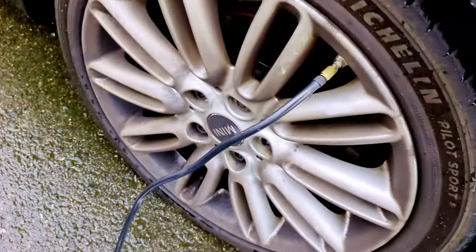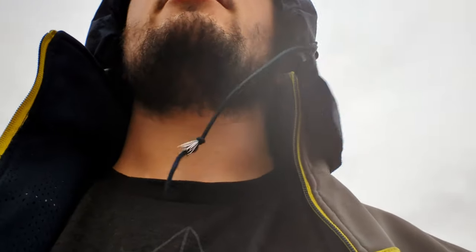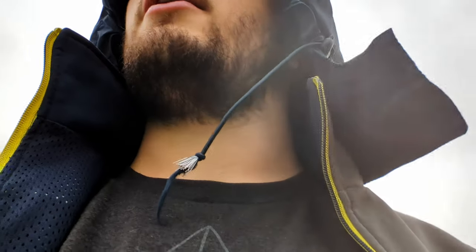It's roasting, the brakes just have stopped working again. It's my main enemy. We are on stock pads, stock discs. Even with the horrific understeer, the car can go faster, but then after four laps pushing, well, I don't know if it can. With the horrific understeer, I don't think it can go faster. So I'm trying to make time in the braking zones where I know I can push harder and go deeper, like the second chicane. Yeah, second chicane, I could be braking like another second later or so because I'm having to come off and then foot back down on the brake to get the weight over the front to turn it in, which isn't ideal. It's just you don't want to go too late and end up off the track sideways like I just almost was. So I'll drop this other front tyre and then take it back out and see if there's any improvement.